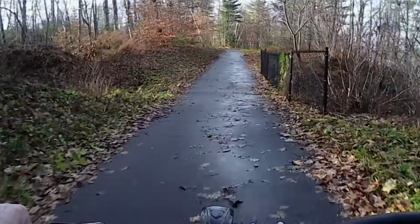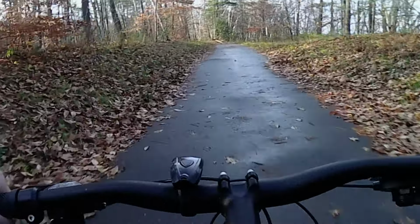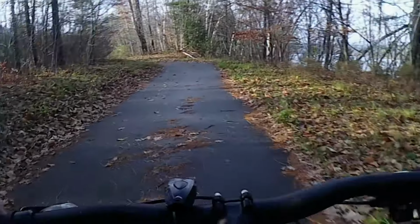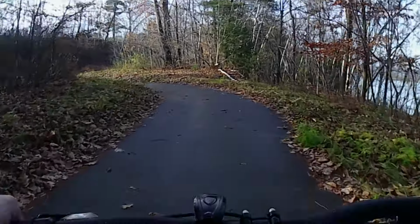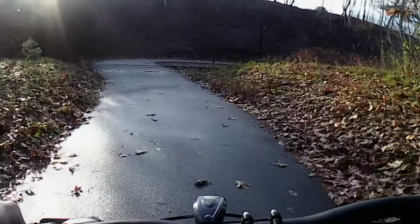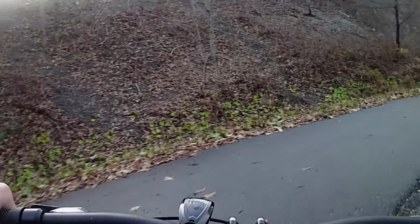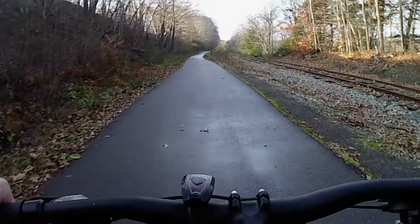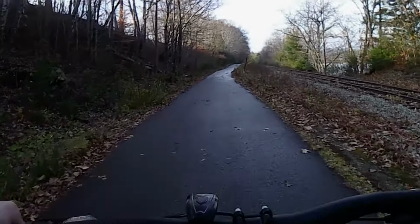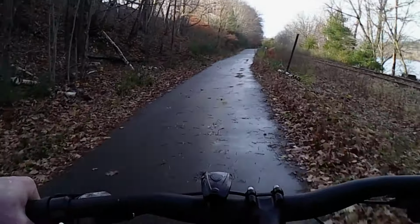The rear derailleur shifted perfectly right out of the gate. Didn't have to do a thing to it. The shifts were quick and precise, which honestly is pretty much all that you can ask of a Tourney derailleur. The front derailleur, well, that was a different story. The shift from the middle chainring to either of the others was slow and not very precise, as you can hear. I fiddled with the barrel adjuster and that helped somewhat. This leads me to think that it's just a cable tension issue, not something endemic to the derailleur itself.